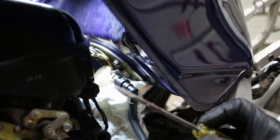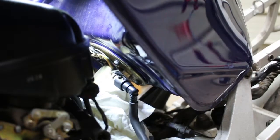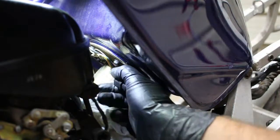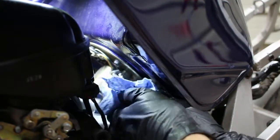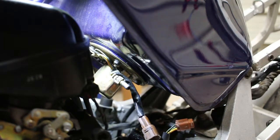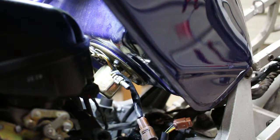You are going to need a really small little flat head. Back in here it's like it's threaded, so once I pinched these and pushed forward, I rotated this kind of connector. Now this fuel line looks like it's ready to pop off — I might get a bit of a spill here. It shouldn't be too much though, just whatever's left in the pump. There we go. Let's pull that down past the tab. There's the two connectors off, and now I'm ready to remove the back bolt. We'll go up top and grab that.